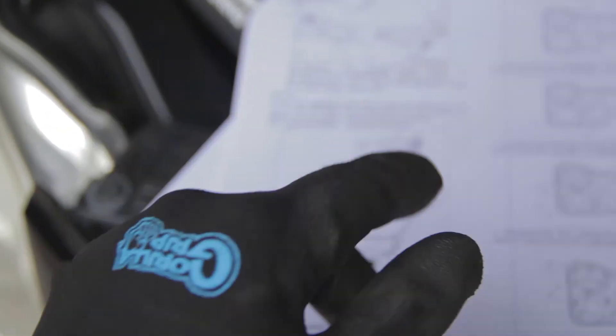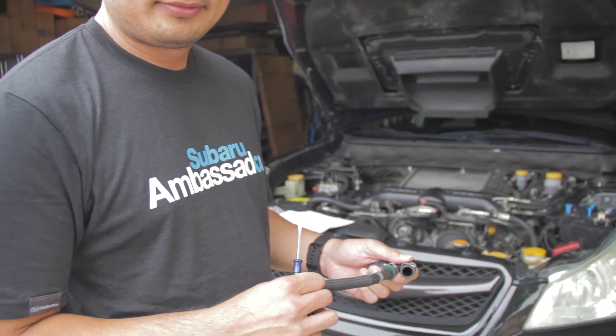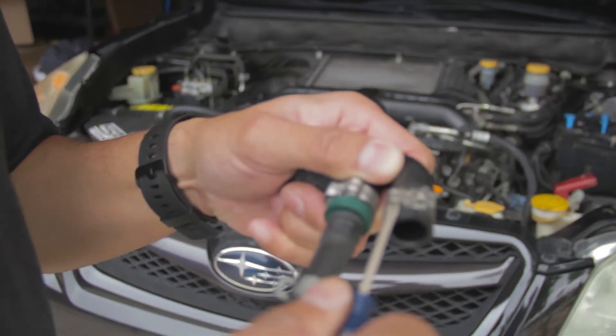That clip I talked about earlier — Long says you just have to stick a screwdriver in and pop it off, which bends the clip so you have to get a new one. I don't have another one right now; since it's just for air and the other one doesn't have it, I think it'll hold until I can get another from the dealership. To do it, stick a screwdriver in and wiggle it back and forth until it forces into the first notch, then pry it off. Long's demonstrating here with a leftover AOS install part — this clip is the same exact clip. Put your screwdriver in and if you twist it, it breaks the crimp.